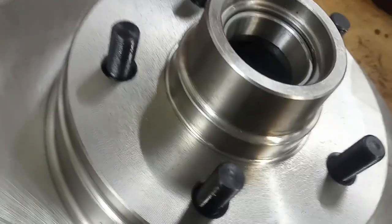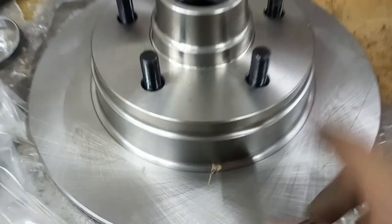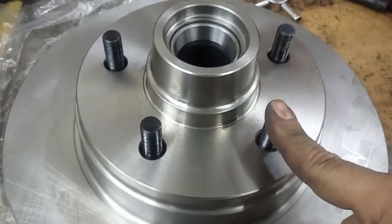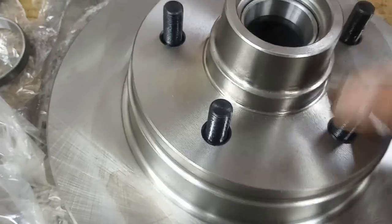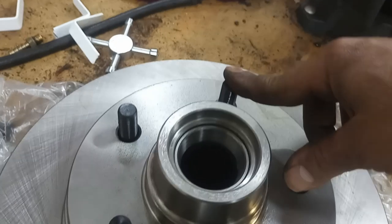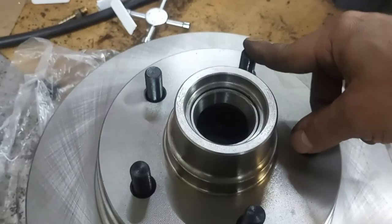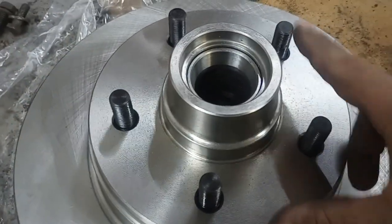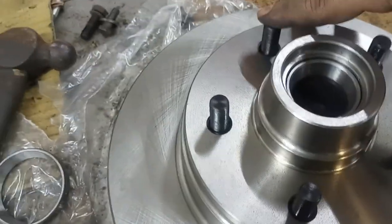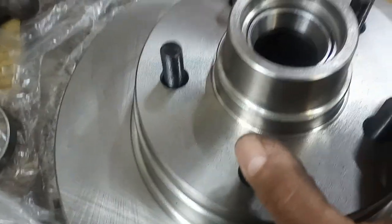You've got to drift out the bearings that come with the rotor. Here's the rotor for Buicks — it's a five on five. I noticed a lot of the online catalogs tell you you're supposed to have a five on four and three quarters. You do not, at least for the 66 Wildcat. I'm getting all kinds of mixed information, but I confirmed they are five on five — five bolts, five inches apart. There may be four and three quarter ones out there, but not mine.